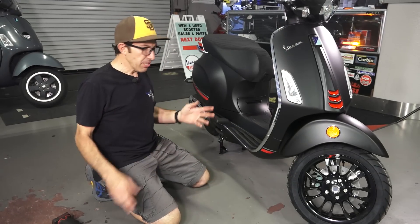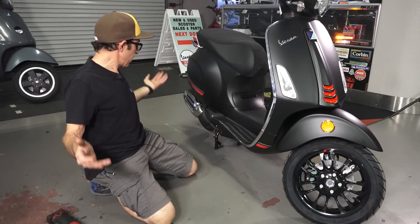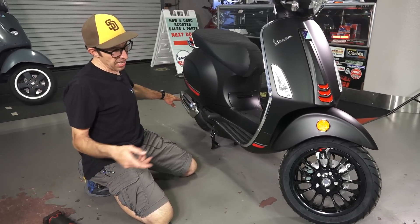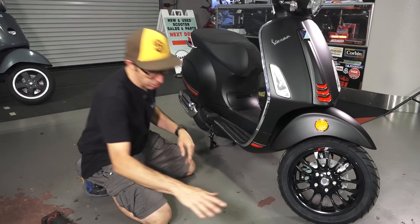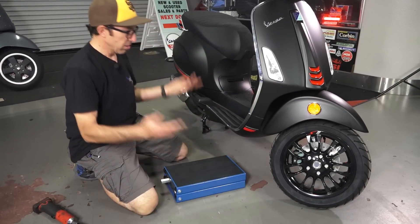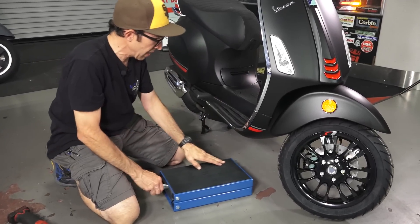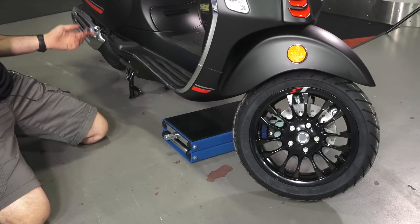Probably the most common use for this jack is to change the front tire. The rear tire doesn't need much — on most modern scooters the center stand kicks up the rear tire. On a vintage scooter, ironically, it kicks up the front tire and you need the jack for the rear, but I'll show that in the next video. On a modern Vespa, it's very flat underneath. If you have the side stand, it's a little bit in the way — just slide the jack towards the front part of the floorboards.